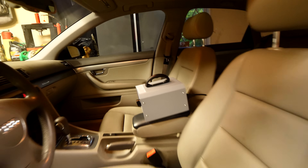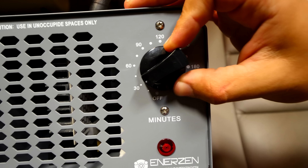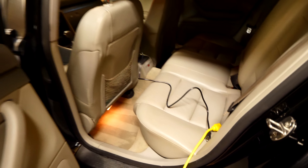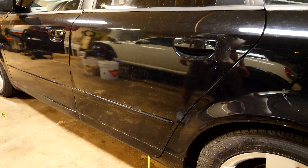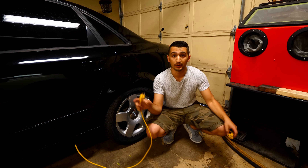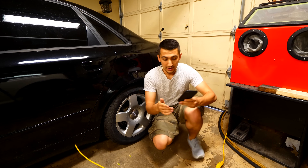I'm not going to plug it in yet. First I'm going to go to the ozone machine and set it up to run for half an hour, so I'm gonna turn the minutes to 30. Then I'll close all the doors and try to have it so that the extension cable or power source is not inside the vehicle. To do that, I'm gonna plug this in but not connect it up yet — so no power to the unit until all the doors are shut. Then whenever you're ready, you just plug these two connectors in and it's gonna turn on the ozone machine and let it run.